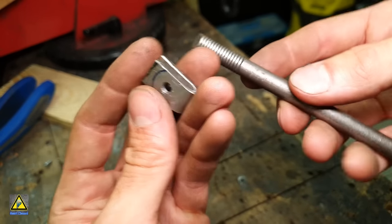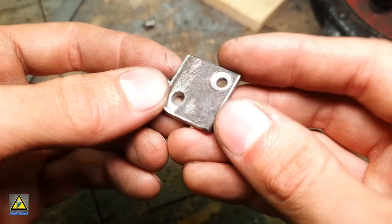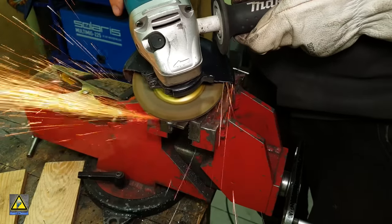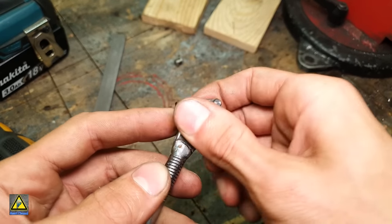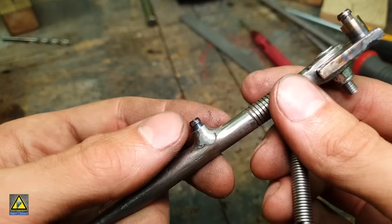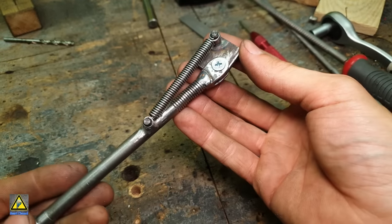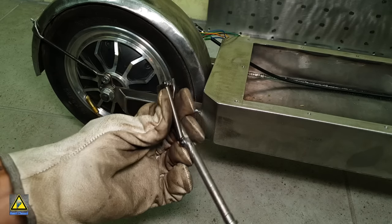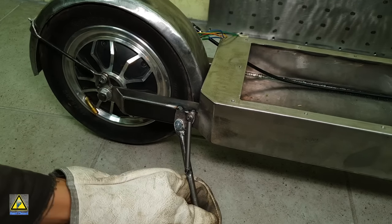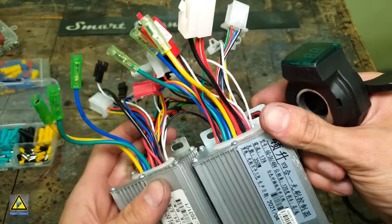I will make the kickstand from a long M10 bolt. I made a metal eyelet and welded a spring catch to it. A similar catch was welded onto the leg. The spring was sourced from an old desk lamp. I decided to weld the finished kickstand not at the center of the deck as done on many scooters, but on the rear fork stay. As it turned out, this placement is no less stable than a center-mounted one and is even more convenient to use.